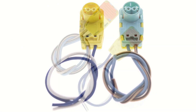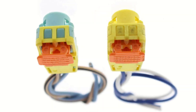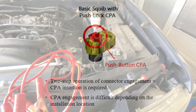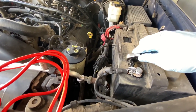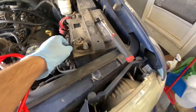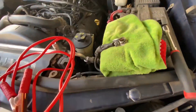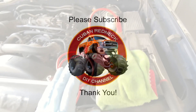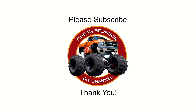Let's address the airbag light issue. As it turned out, it was human error — the airbag connector has an orange clip on the back, and the clip will not go into place unless the connector is properly seated onto the airbag. If the clip doesn't lock, it will trigger an airbag light. Before you panic, take the airbag back out and inspect the connections first. After resetting the trouble codes for the airbag, we had to resort to an old method: jumping the battery terminals after disconnecting the positive lead, since FORScan and several other softwares including a Snap-on code reader failed to clear the code. Simply disconnect the positive battery terminal and connect the positive and negative cables together for about 15 to 20 minutes. Thanks so much for watching — a lot more Ford Maverick content is coming your way!